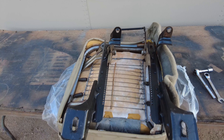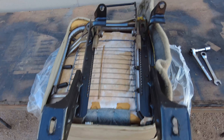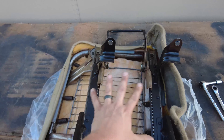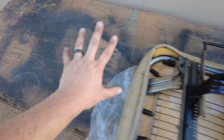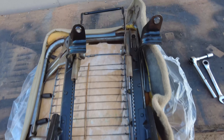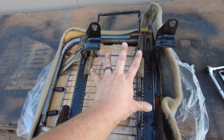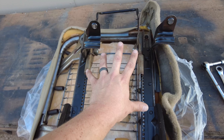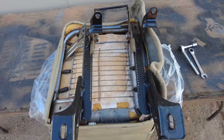What I learned to make switching the brackets the easiest is just put the seat on a workbench or a table like this, remove the four studs, and then take the entire adjustment bracket and set it next to the seat. Then put the new seat just like how this one is, bolt the adapter plates to the bottom of it, pick the adjuster up and set it onto the adapters. That way you won't get anything switched around or confused and it should go really smooth.